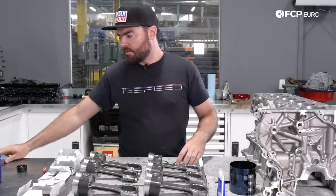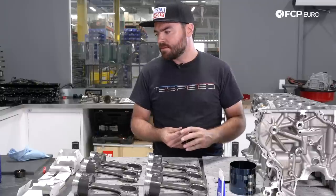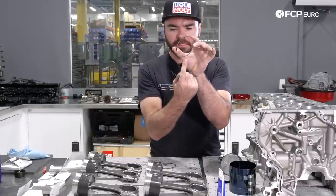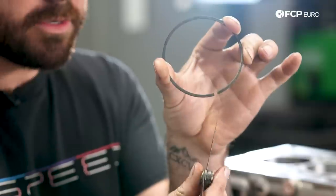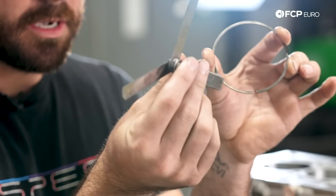We file fit the rings to the bore using math. For this example, we took the bore size and multiplied by 0.0055 — for the top ring we got about 20 thousandths, and for the bottom ring we chose to set it at 25 thousandths. You always want your second ring gap to be bigger than your top ring gap, as that helps evacuate any unnecessary pressure in the cylinder. Each ring has an end gap, and we install each ring individually in the bore and measure to a target end gap using feeler gauges.